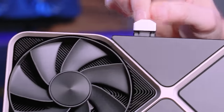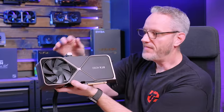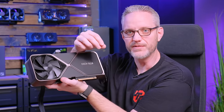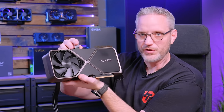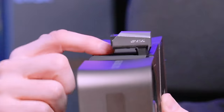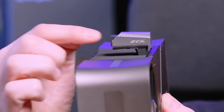I do have a concern — not CableMod's problem so much as the original issue that was causing cards to burn up. Do you see the wobble? The wobble is not in the adapter itself; it's wobbling inside the actual 12-volt plug in the card. That's part of what was leading to cards burning up — it put more resistance on pins not making full contact. So if you're going to use any adapter, make sure it's seated all the way down. Once it's clicked, it's fine; just make sure it stays straight. The downside of this variant is it's tucked away under there, so to unhook it you'll need a plastic spudger tool — don't scratch up your card to release that tab.